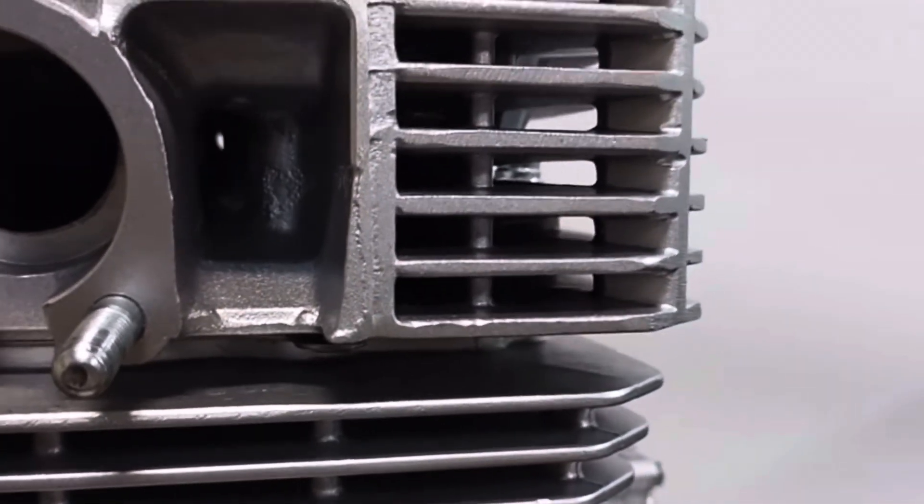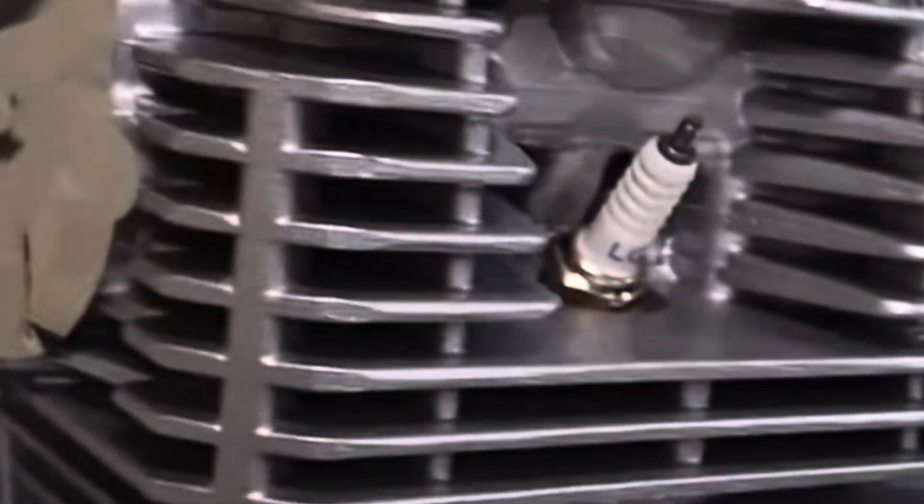I wanted to stay old school with the air-cool. As you can see, this particular engine has unique features. The head has really wide fins on it, so it really catches that air. And if you look on the front, there's a big port that goes through the front, clear to the back, and it comes through the side — that lets air through there to cool the head. The bottom of this engine is used for everything; they just stack whatever they want on top of it. It's kind of like a universal engine. They have an air-cooled and a liquid-cooled version, all kinds of versions. They also have a counterbalanced engine, which is more for a street bike application.